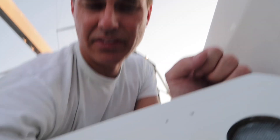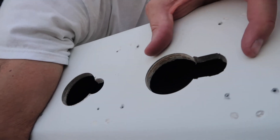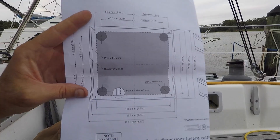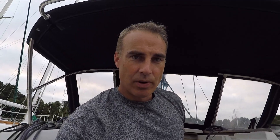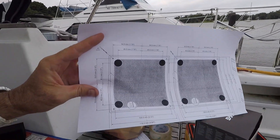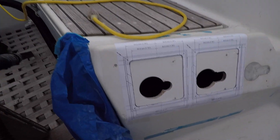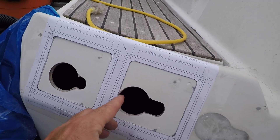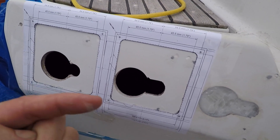Now I can fill in the rest of that hole, and then these other two I'm going to work with — cutting out a huge square in the same spot to fit the new screen displays. It comes with a template; you cut out the shaded area. I went and made a photocopy and placed them perfectly side by side. The old holes and the one I filled I'll actually paint. I've taken this right to the edge because I wanted to move it over as far as I could. It's always nerve-wracking making the final cut in fiberglass, but might as well make it happen.